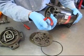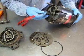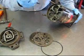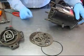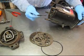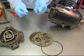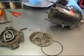Use some needle nose pliers — the tube sits on an O-ring and can get pretty stuck. We got the oil pump tube loosened up; it was a little more stuck than normal but it did come out. It's just a copper tube that goes down into the sump and there is an O-ring on it. A lot of times they will stay stuck in there, so be sure to get it out.